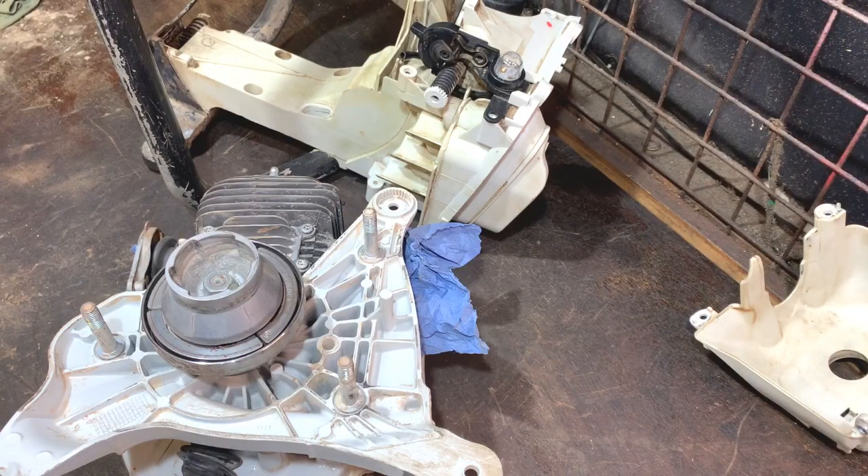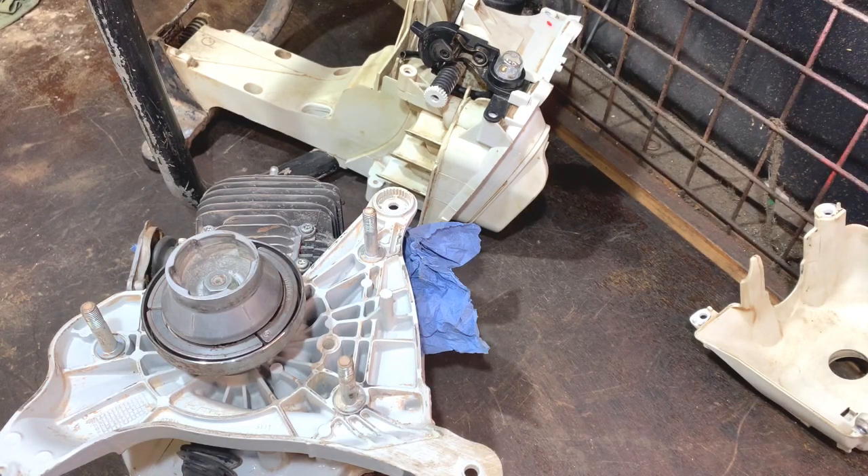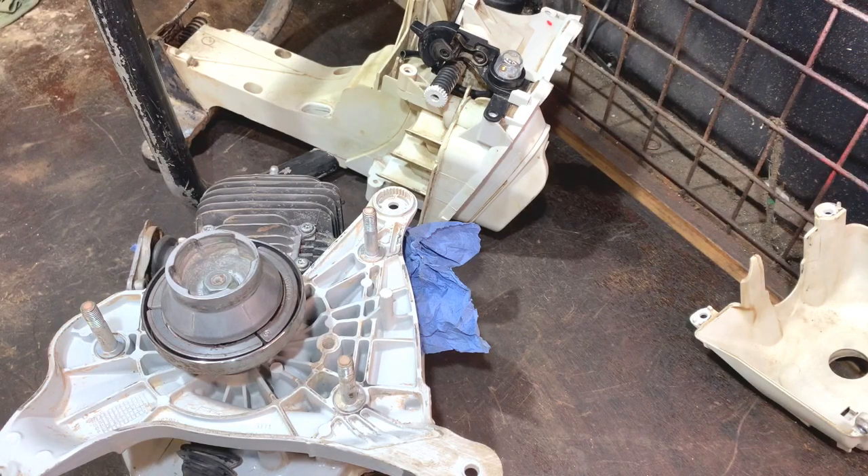It's quite a few days on now and I've been doing lots of cleaning of this Stihl TS-410 cut-off saw. It was absolutely covered in dust everywhere and I had to pick it away with a screwdriver and blow out with an airline. I washed it first to get the worst off, but it's been a bit of a nightmare to be honest. I've got it okay and I'm quite happy with how it looks now. I have cleaned the carburettor — that's all done. I've done a separate video of that, so I'll put a link in the comments and in the description. If you want to know how to clean the carburettor and fit a new diaphragm and gasket kit, pop over to that video.